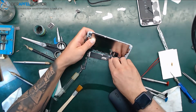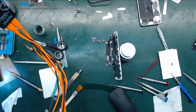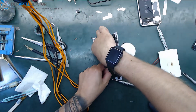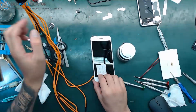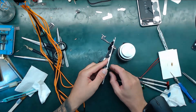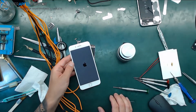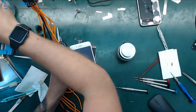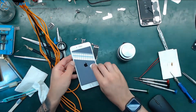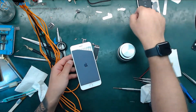Now let's take the on-hands camera, the screen of the device, and our DC power supply. Here you see we got an Apple logo again and the device boots. Fast job — eight minutes, with disassembly of the device, taking out the board, finding the short, and replacing the cap. Now we just have to get a new glue sticker on the back side of the board and assemble the whole phone.